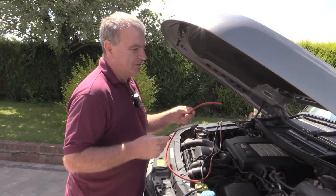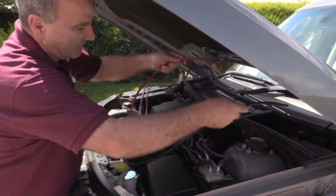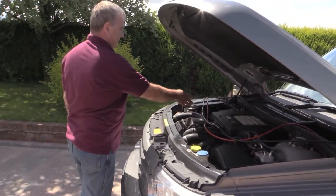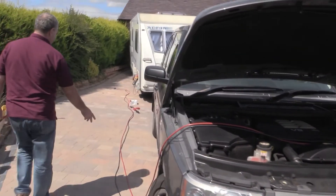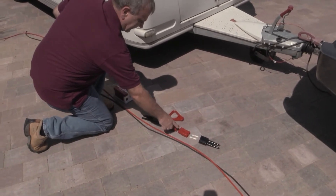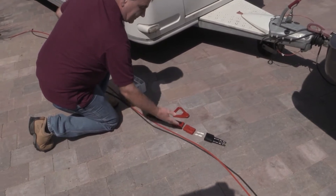Purely from the point of view of convenience, we're going to run these extra cables on the outside of the vehicle just so you can actually see what we're doing and how simple it is. The negative goes to the negative of the battery and the positive to the positive. At the connector here we have two Anderson sockets rated at 160 amps. The reason we used 160 amp is that it jumps from 50 or 60 amps up to 160, and the cable is quite thick so we just went for the 160.